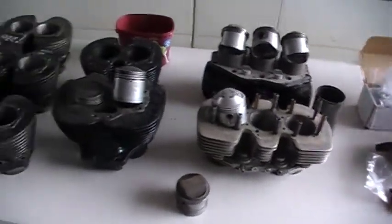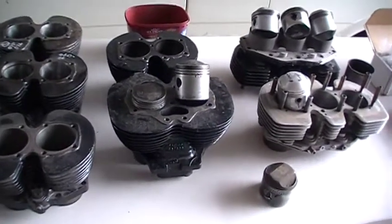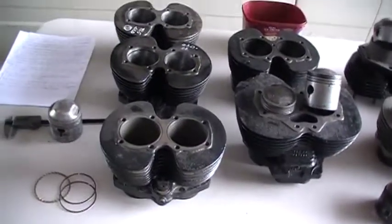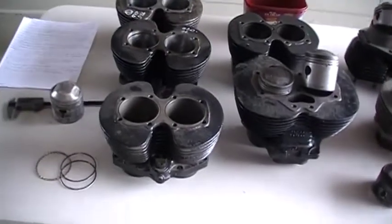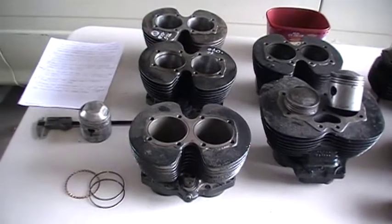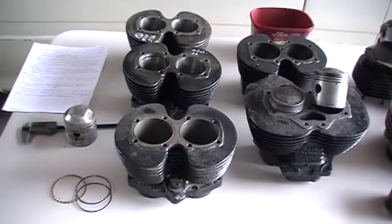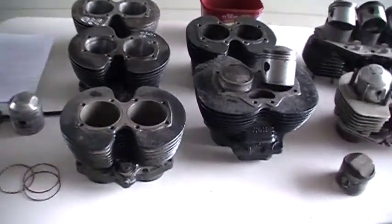That's a more interesting way to set up a triple. You can balance them somewhere between 42 and 52 percent, whatever takes your fancy, and they work out all right. Anyway, that's triples with three-piece rings and a big bore kit, even an A10 with three-piece oils on a four mil, and a couple of 650 pre-unit barrels that I've got about another half dozen of on different projects — all cleaned up and converting to three-piece oil, four mil. Anyway, thanks for watching.